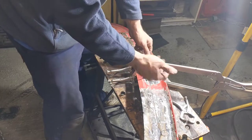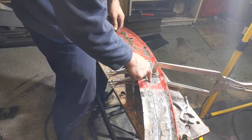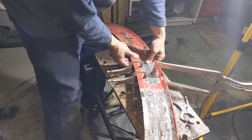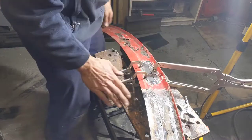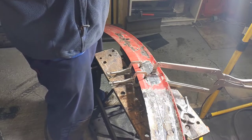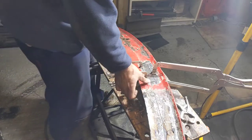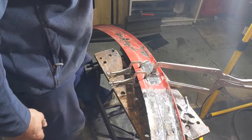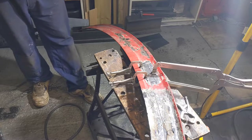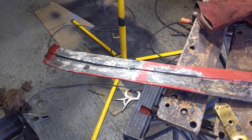I'm trying a slightly different approach because I struggle with butt welding so much. I've cut the edges a bit too big but I used my joggler to lay it underneath, so all of this here has metal on the other side as well. That does leave a little bit of a lip, but I think with a bit of weld and then a skimmer of filler it should be okay. I'll just have to use a bit of brass behind this to weld it up nicely.